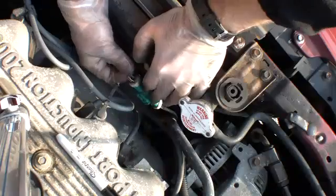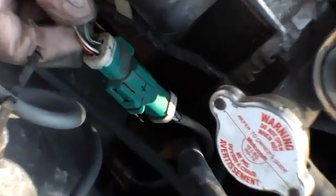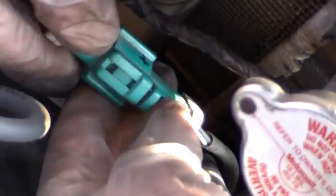The challenge is that these wires are colored and I don't have the legend for what these colors are, so I'm needing to find both a positive and a negative — which is the battery voltage to the heater — and the signal and return lines, which need to be measured while the car is running. This vehicle is obviously not running, the key is not in, the electrics are not on, the whole thing is off, and we're going to disconnect this.